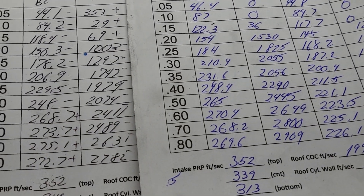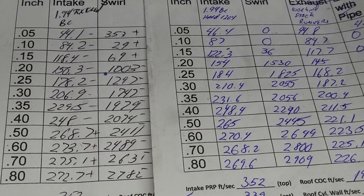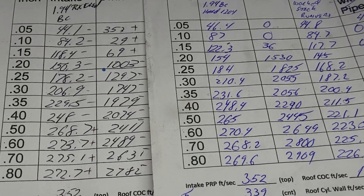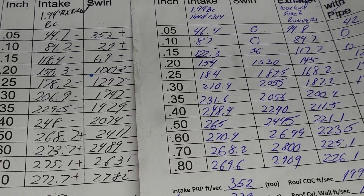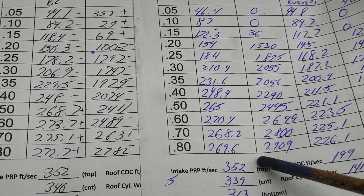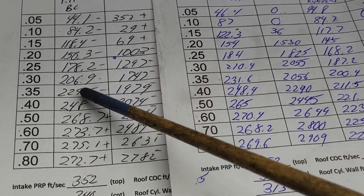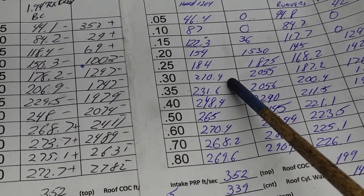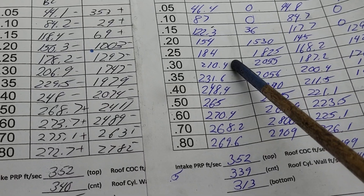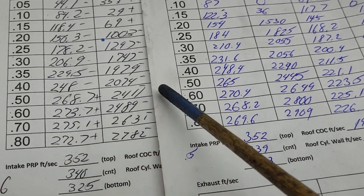You have to remember what we're trying to do. The textured valve is meant to break up fuel a little, add a boundary layer — and it will be wet flow since we're injecting at the entrance of the intake port. Looking at the pluses and minuses versus the last test — we were around 270 at 600 — we're showing minus all the way to 400 lift. We're still at 206.9 but were up to 210 before. That prior test was before texturing, before bowl equalization, and before rounding the pinch. At 500 and 600 we got a little bit of a gain.